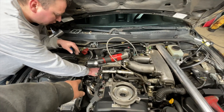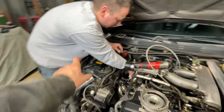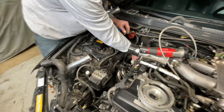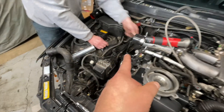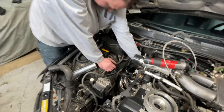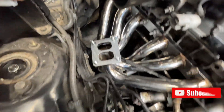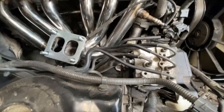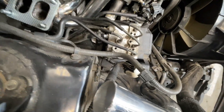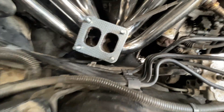For the lines, we are moving just one of them. The rest should be all right where they're at, especially since Matt made that remote pipe over here. We're going to just twist this so it's not touching anything — rotate it the other way and it should bend away from the manifold. Manifold's in. That line, I thought it was a vacuum line but there's actually brake fluid in there. All we did was unplug it, pull it out, rotate it, and shove it back in. So it's away from the manifold and I think we're all right.